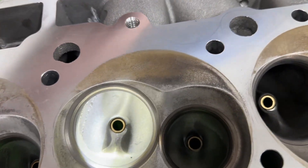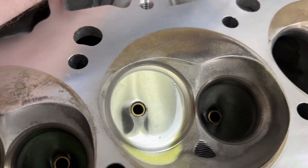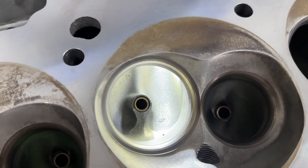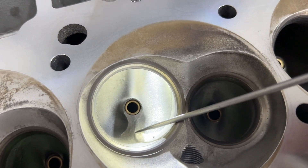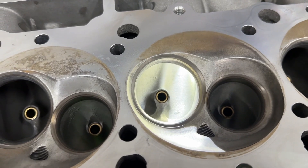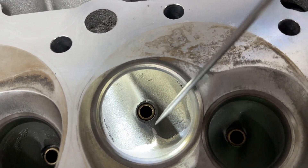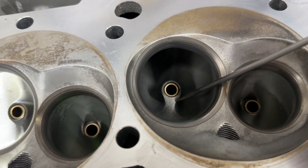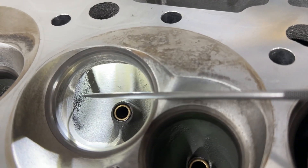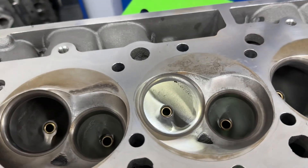I'm going to be completely honest about this. The port design looks better on the 305. You see the valve itself and the vane area — on the 305 and even the 325s, this area is far more profiled and better, which is odd that this one isn't. It's not as clean. That short runner one is not pretty at all — it looks like a Dart from back in the day. There's some material there, but don't get too worked up about it. Everybody thinks 'if I grind this off I'm gonna gain so much flow' — you ain't gonna gain one CFM. Weird how that works.